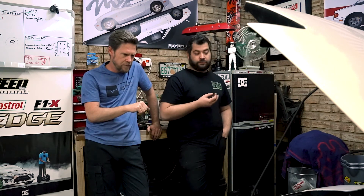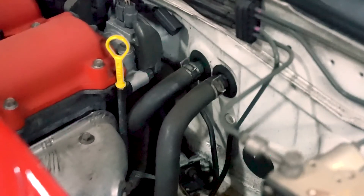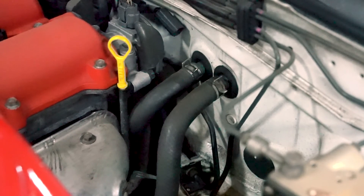I have a sneaky suspicion — those of you that have followed the Instagram account know I had a bit of a water leak down in the back: the heater hoses. I could be leaking by the heater hoses, which are something that will need to be addressed anyway because when we run the turbo downpipe, it goes right past those heater hoses. So those almost need to be rerouted. I'm just curious as to where the water's going — it is losing water, maybe a quarter to a third of the radiator on a long 200-kilometer drive.